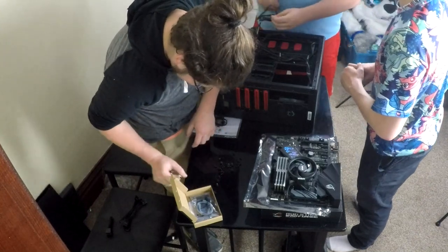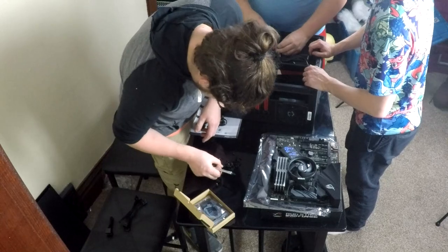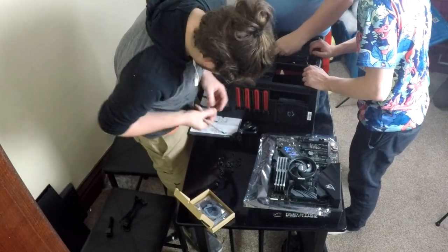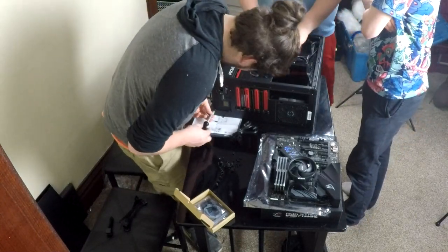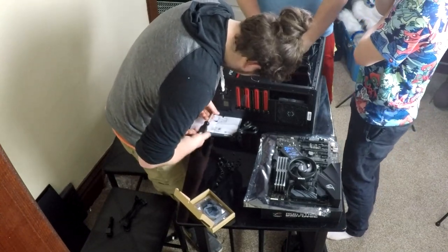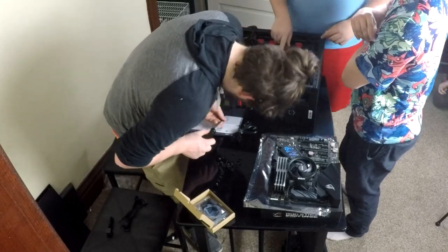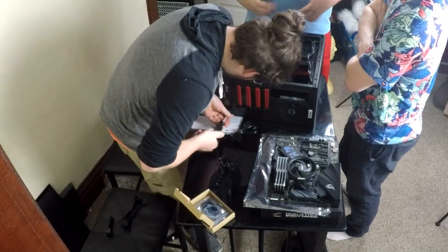Okay. All right, so what I'm going to do is the first one of this lead, I'm going to plug into your computer stuff, because that needs 12-volt power. That's why that's a SATA connector. What's nice about the SATA connector over the Molex is some drives now require a 3.3 volt, and this is all 3.3, 5, and 12 volts. Whereas Molex only had 5 and 12.